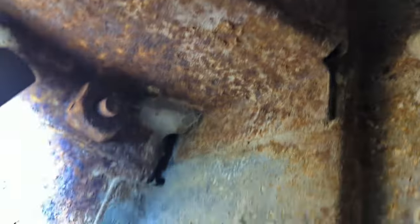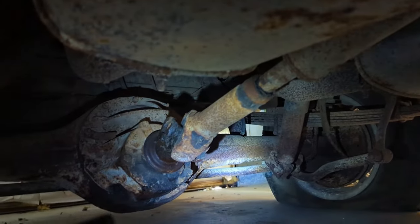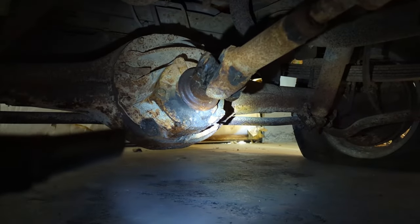Going back to the rear floor pan — there's rust on things. This seat belt bolt mounting area is a little grubby looking, a little scaly, but it's not thin by any means. Up under there where the other seat belt bolts are — she's good, really good. The rear discs and everything looks pretty dry. It had some wet on it maybe from sitting all these years, but it's dried up. Won't know until you run it. The rear pinion looks pretty decent — I'll check the fluid in it.